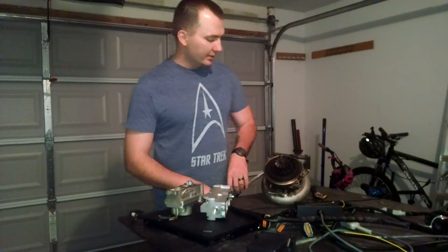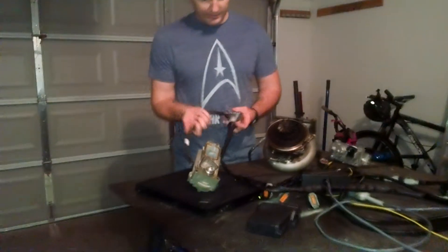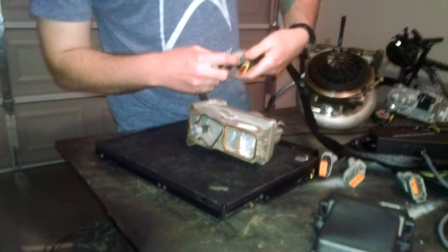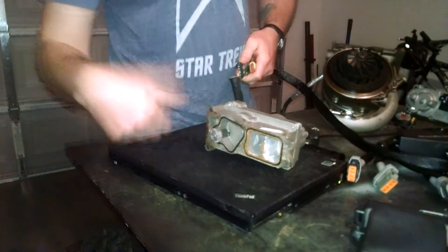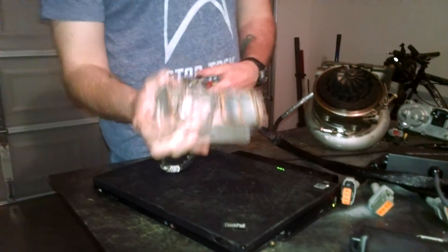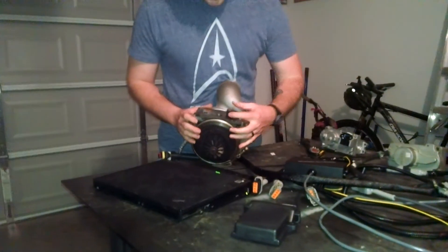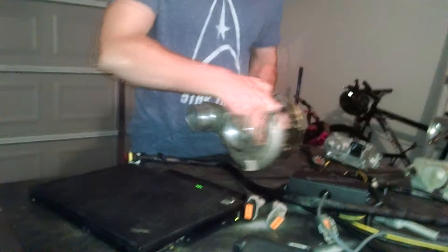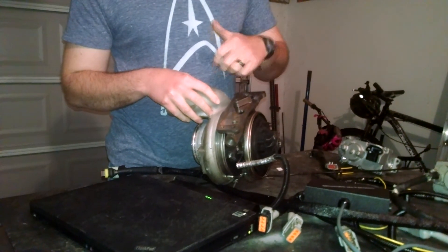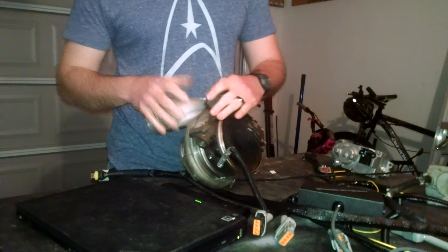What you're trying to do — and I'll show you with the 351 — is the gear inside the 351 is actually going to rotate about 360 degrees. It's spinning around and going to an index position. Once it's there, leave it connected, leave it powered on, and slap it on the turbo. When you get to the turbo, with the actual gear, the turbo will be mounted in this position and you're going to turn it counterclockwise as far as it'll go. You should be able to do it with just your thumb — you don't have to crank on it. As soon as you get all the way counterclockwise, the sliding wall should be all the way in, and that's your starting position for when you put everything back on.